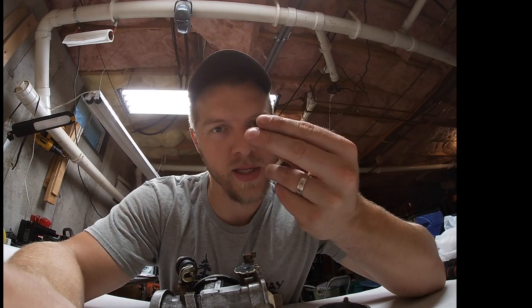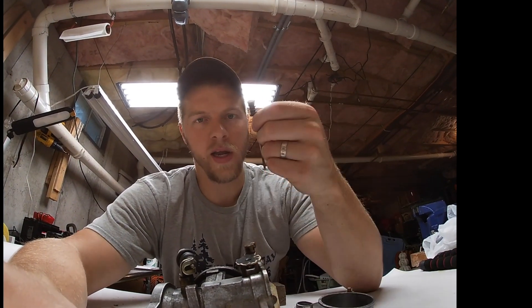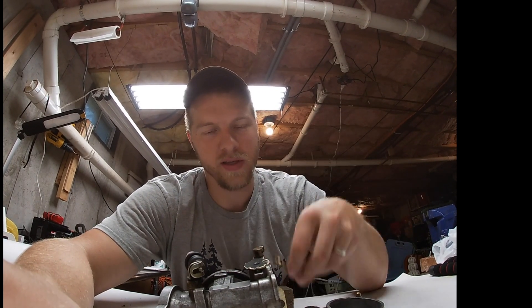New bikes need a fully charged battery, have oxygen sensors, and if you start modifying them — changing pipes, changing intakes — they won't run at all. You need to bring it back to the dealership to reprogram it, and that means money. This right here is manual adjustment. This adjustable main jet — there's no dealership needed. I am the dealership. That's why my bikes, chainsaws, everything is older — because you can still work on it.